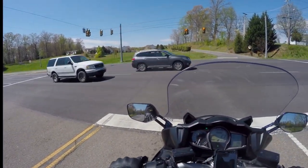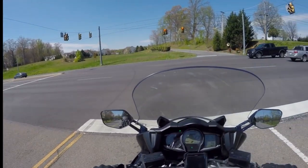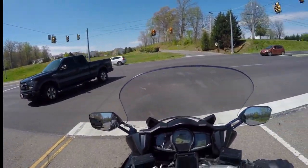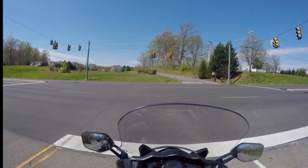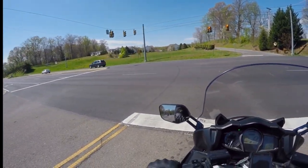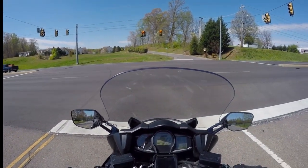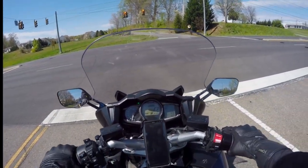The exhaust is really easy to put on compared to stock. There's literally one pinch bolt for the exhaust mid pipe, one bracket to mount the muffler, and three springs on each exhaust — that's it. There's also a little cover that says Yoshimura to hide where the mid pipe connects. Taking the old one off and putting the new one on is maybe an hour and a half total. If you can change the oil on a bike, you can put on one of these Yoshimura slip-on systems yourself.